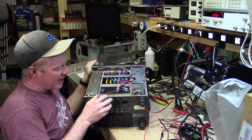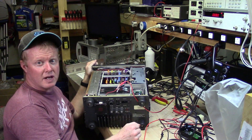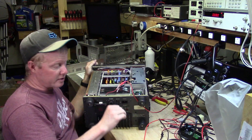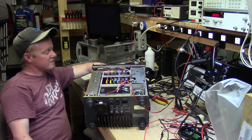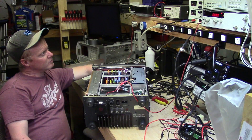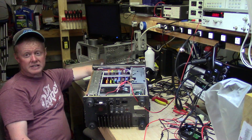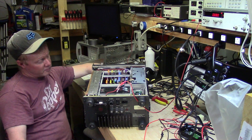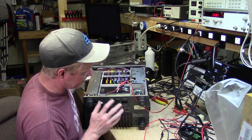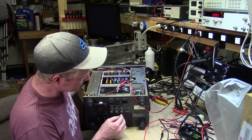I've been playing with this for the last little bit. The fastest way to diagnose what's going on: I went to battery, disconnected the batteries, and basically hooked it up to a DC power supply with current control to see what actually happens when you turn it on. It's got off, standby, and run mode. I did have to replace the fuse. Right now we're pulling about 0.8 amps just in standby mode. When I go to the on mode, my relay clicks on, and either the power supply drops out or it's just simply not pulling any power. I really need to take a look at the actual power supplies themselves, which is going to require a lot more disassembling.